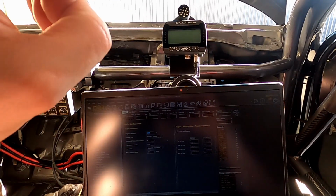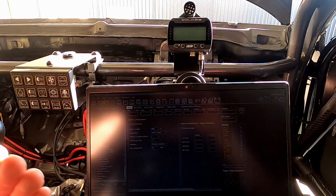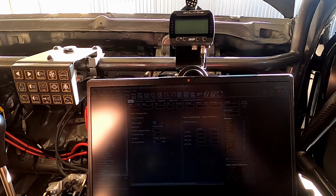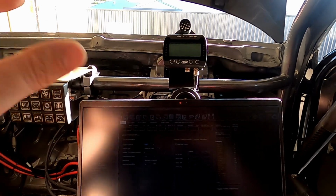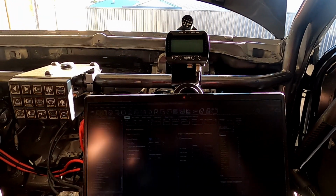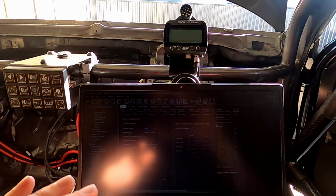I'll have it flash at me quite slowly, on and off once a second, if there's a moderate issue, so temperature's just gone above a set limit, like your coolant temperature gets to, let's say, 105, so it's getting up there but it's not ridiculous. And then I'll have it flash very quickly at me when there's something serious happening, so temperature's gone way too high or oil pressure's gone to nothing, and that's when I need to immediately kill the car and stop it.